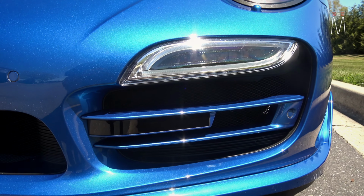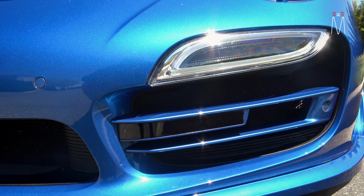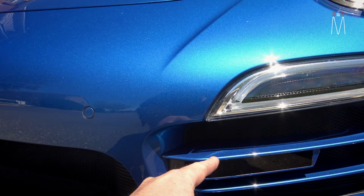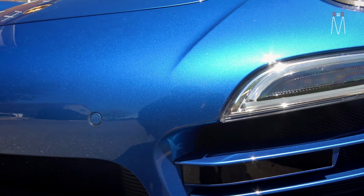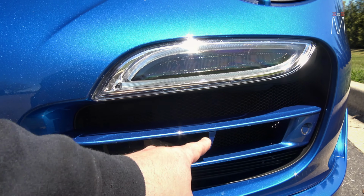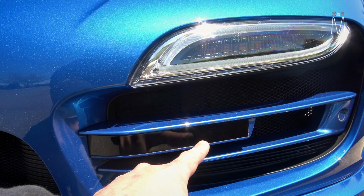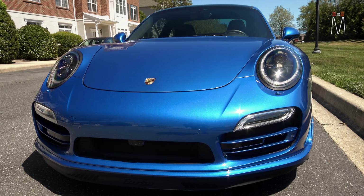The side ones actually came out super awesome. They're always kind of hard in this style bumper just based on how you have to mount them. Essentially, the sensor's here. You can see it rotates and it bends with this arc up top. And we use IR acrylic as the face that is heat bent and put into place right here. This outside is the pod housing, and again, you can see it's paint matched there. And the sensor is roughly right here. So it's pretty much the widest we can get that sensor.